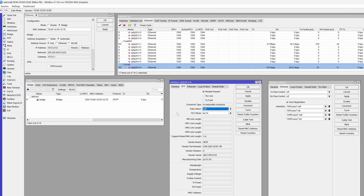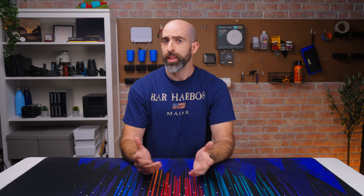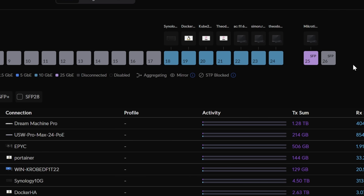After having the connection not work, I went into the settings and eventually found out that I needed to set the port's FEC mode to FEC 74. What this means, I really don't know — go Google it. With that, I was able to just plug in my 40 gig devices and have everything talking to each other.